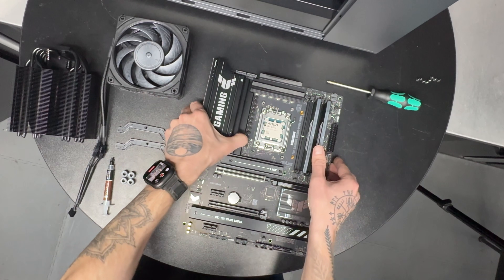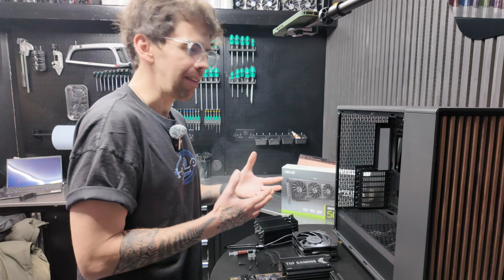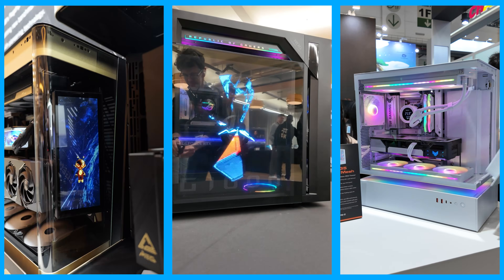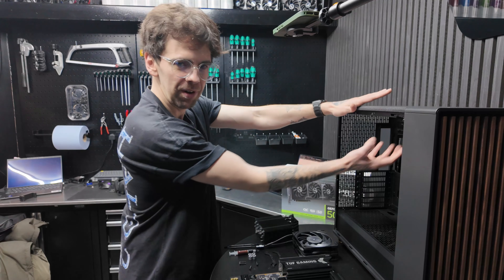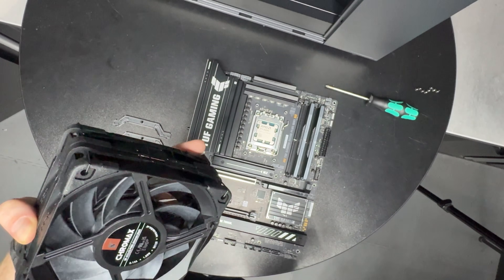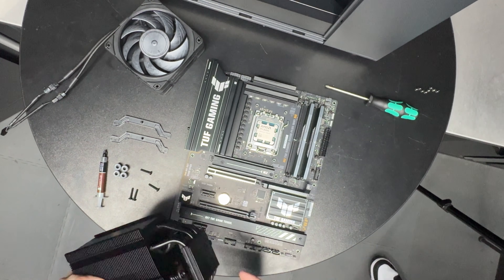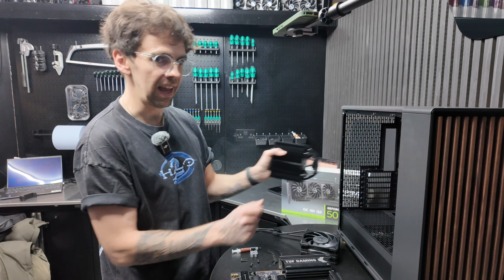So we need to keep the CPU cool and you've got two options. Option A, and probably the most cost-effective and easiest one to install, is a fan cooler. Option B is an all-in-one liquid cooler. For an AIO cooler, you're going to want to install that after you've put the motherboard in so you can measure it all out properly. But with a fan cooler, given its much smaller dimensions, you're going to want to put it on now — it saves you a lot of hassle of trying to eye it up when it's in the case.